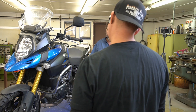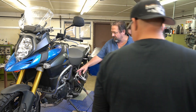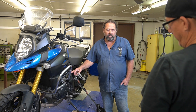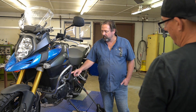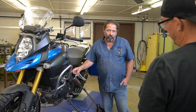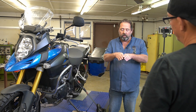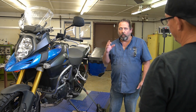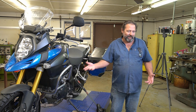If you slam this bike that hard, you're going to have other things to worry about. All this is mild steel, but it's 11 gauge - which is one-eighth inch thick. That's some good stuff. And that is DOM - drawn over mandrel tubing. It's not tubing that's welded together with a lateral weld - it's actually forged. This is the strongest mechanical tubing that you can get in 1018.